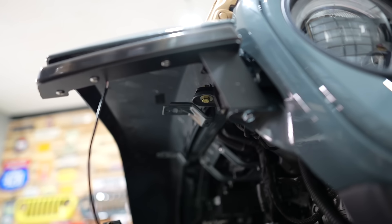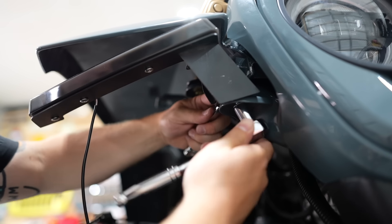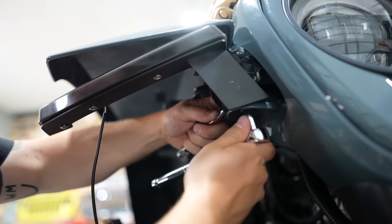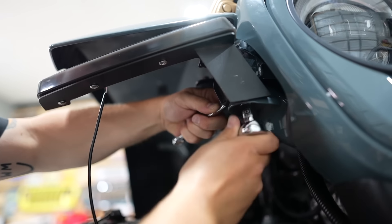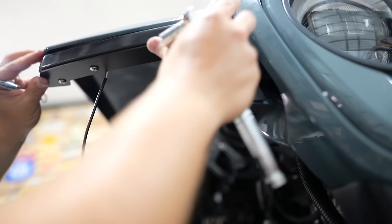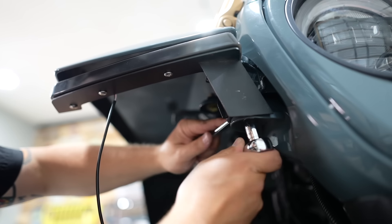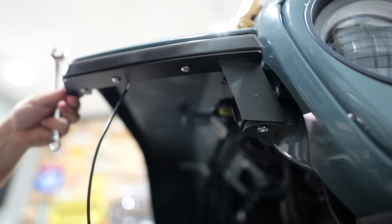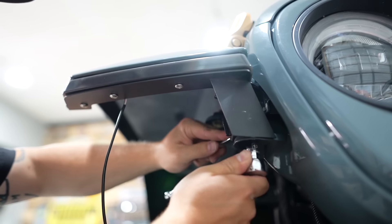Using a 13 millimeter socket and a box wrench — don't worry about it falling. I started both of them. That would have been an expensive fail there, Ryan, slipping that wrench into your camera lens. I'm just going to snug this one up and as it's pulling up, you can adjust it out here. As you're tightening it, you'll start to see where your adjustments need to be made to get it really perfect. It's actually pulling up your fender too, which is nice. You can feel the structure getting back to what it should be.